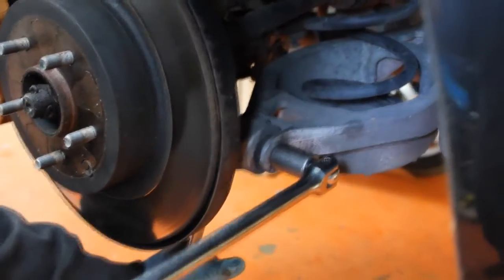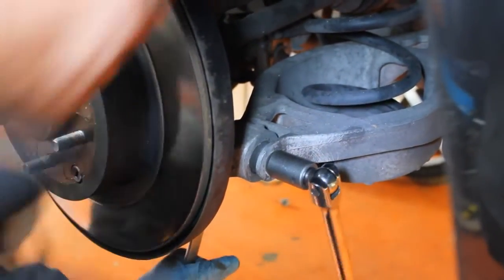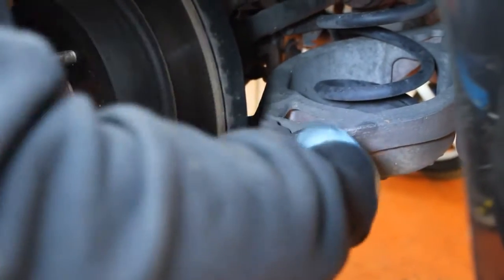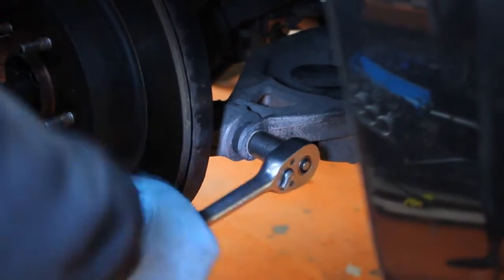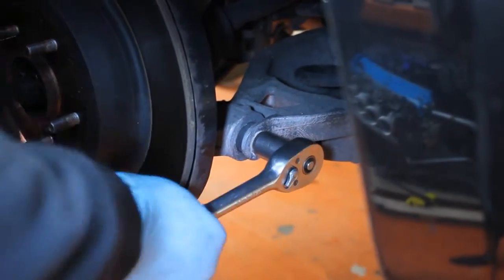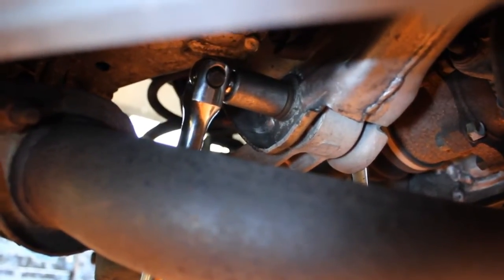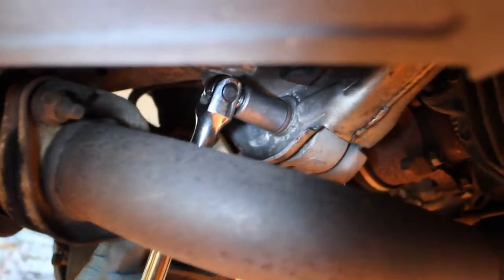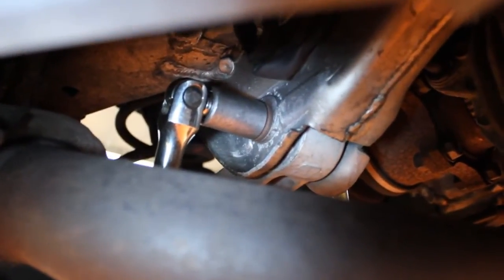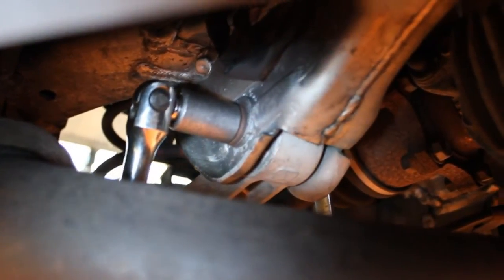So now onto the rear, loosen the outer toe arm bolt. We're now going to loosen the inner toe arm bolt to allow enough movement in this arm to remove the spring. Bear in mind that this is an eccentric bolt used for toe adjustment, so mark where the bolt was originally so you can adjust it back to the same spec. Please bear in mind though, any changes in ride height you do make, you will need a full wheel alignment afterwards.